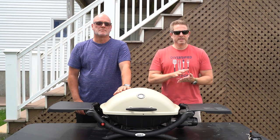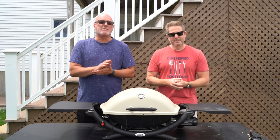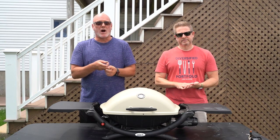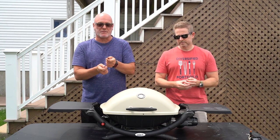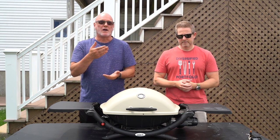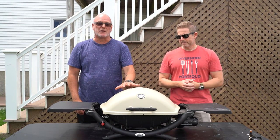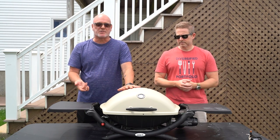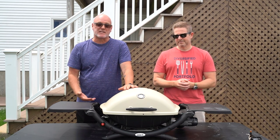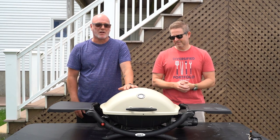It's one of the most common issues people have with their Weber Qs, especially as they get a little older. If your igniter isn't working: first, check the battery. Second, check the wires to make sure they're pushed in — especially if you have windy conditions or if you're traveling with it, things can get jostled around. Lastly, a lot of times Weber will warranty these electric igniters for the life of your grill. If you've registered your grill on Weber.com, you can file a warranty claim and they may replace it for free. If not, it's about a $30 part for the new electric igniters.